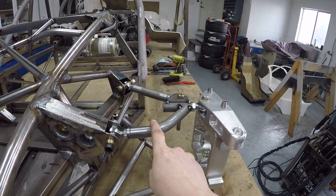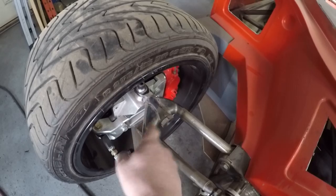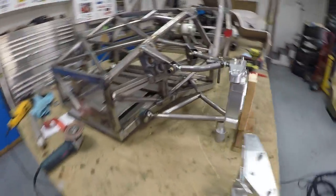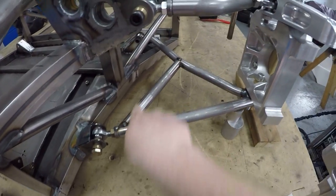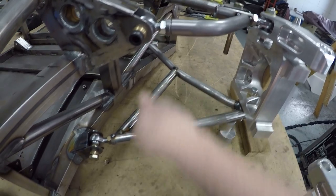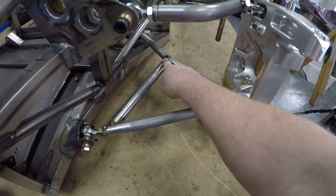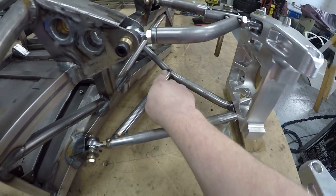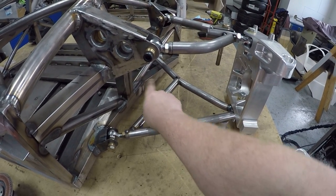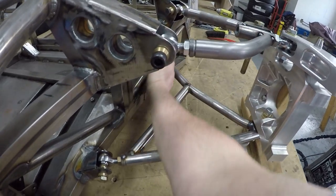There'll be a web here, and basically this piece here will be covered by a plate that comes up. Like on my car, we'll reinforce these corners with a wrap-around piece of 1.5mm thick steel to fill this void and give it more strength. This tube is bent at this corner to miss the wheel. Ideally you'd want the centre of the bend positioned further back, so what I'm going to do is weld the tube there, then come from here with 1.2mm thick steel, wrap it around, and do the same thing. That straightens it out and gives this section less of a bending moment.